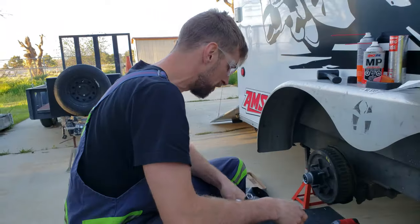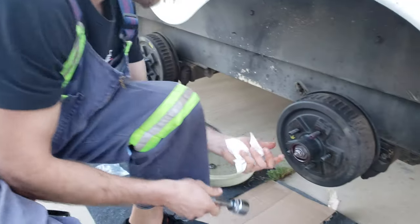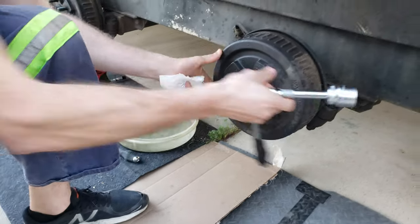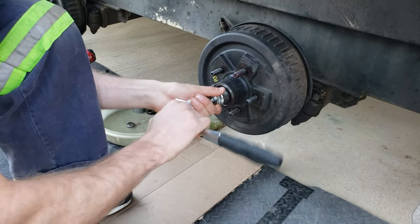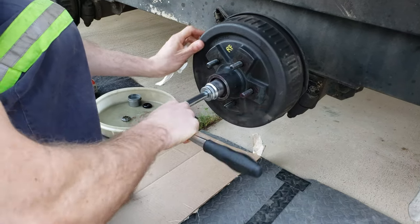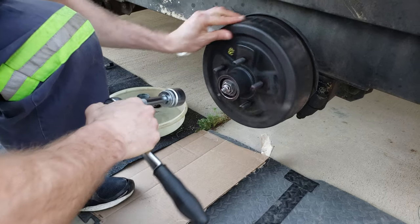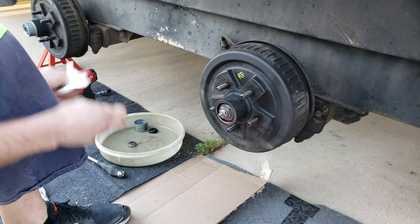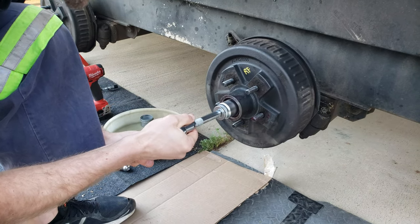What they suggest is you first want to seat the bearings. A lot of people debate whether the bearing should be tight or not. You want to actually squish the hub assembly because it's going to be loose off the bat. You actually do use a little bit of torque and you want to spin it at the same time, tightening the bearings down — nothing too much — until it slows down and doesn't spin much. Then you want to back it off, take the tension back off.